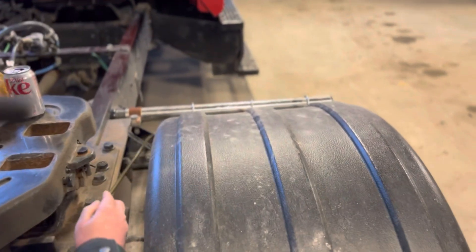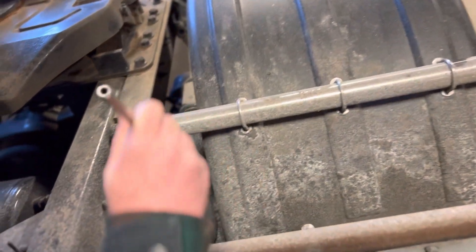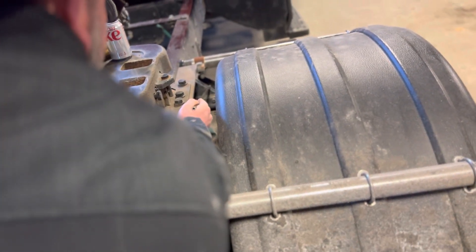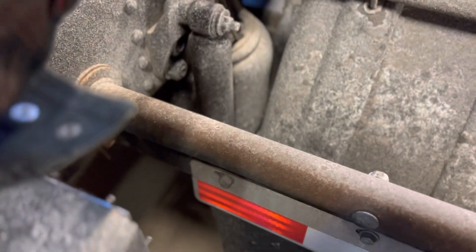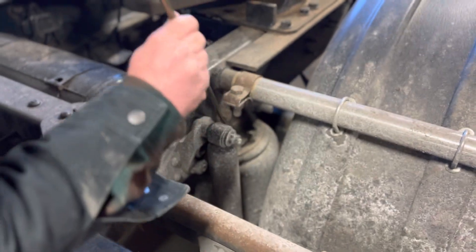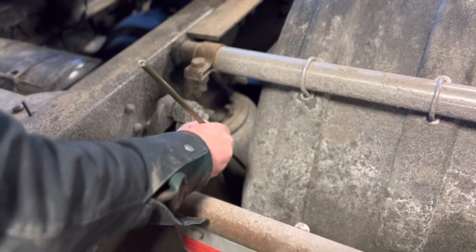Spring and air mounts. This is my spring mount right here, and my airbag mounts are right here and down here. My spring mount up here is not loose, not cracked, bent, or dented, no missing nuts or bolts — the spring mount is securely mounted. My airbag mount right here and also down here is not cracked, bent, or dented. There's no gap or space between this mount and the frame, and no missing nuts or bolts. The airbag mounts are securely mounted.